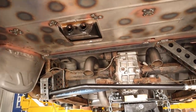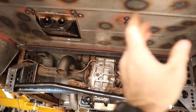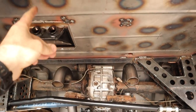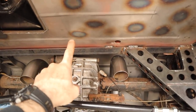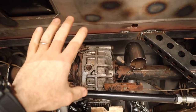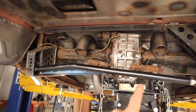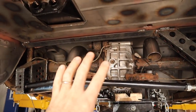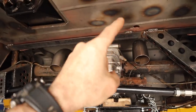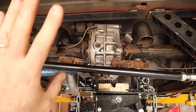I've been doing a lot of head scratching. This is the outlet to the fuel tank — one will probably be blocked off and this one will be the one I'll use. I'm going to have mufflers going either side. My thought is to run fuel filters and stuff in a loop from the back, moving forward — filter, fuel pump, filter, regulator — and then move the fuel forward. I'm going to run a dead-head fuel system, the same sort I used on Harry. Instead of having fuel run through the fuel rails and return all the way back along the car, I'll run the fuel out of the tank through a regulator, back into the tank from the back, and then just run a pressurised line at the right pressure from back to front. That means I only have to run one line all the way to the front of the car.